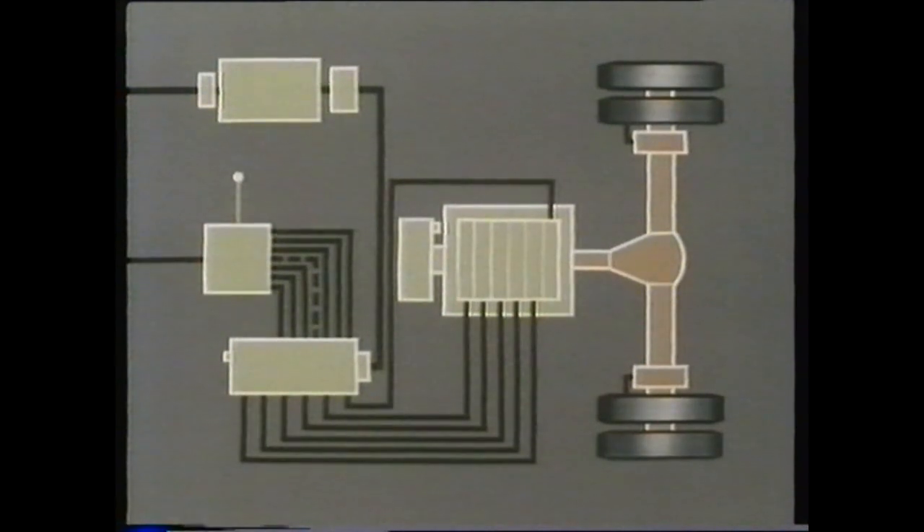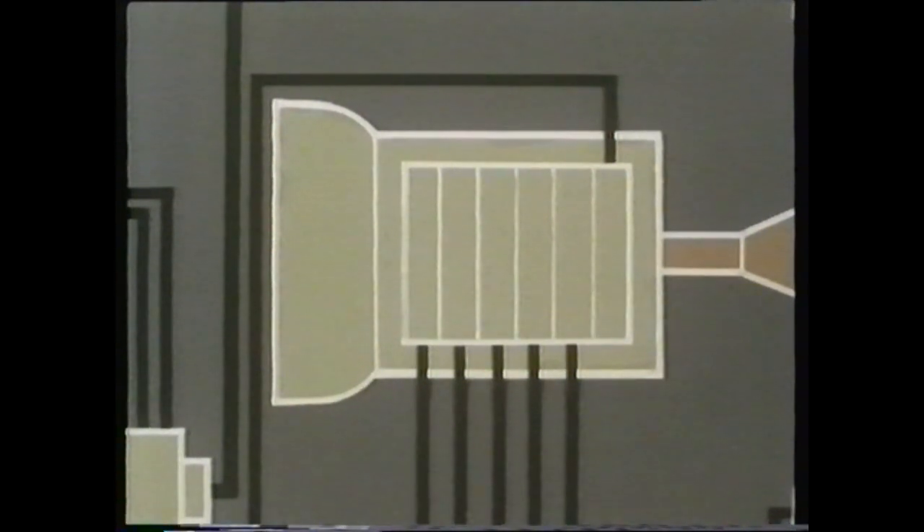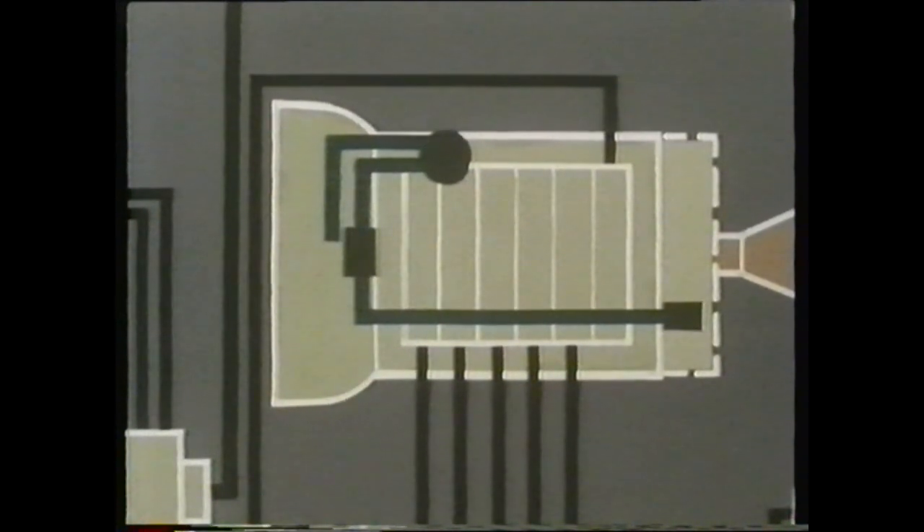There are two main types of pneumocyclic gearbox, but the main gearbox casing is the same on each type. This gearbox, for example, is a remote mounted type and, having a separate flywheel, both the gearbox and the flywheel have independent oil supplies. A Leyland National, for example, has a close coupled gearbox with a charged flywheel, meaning that oil is pumped through a pipe system from the gearbox to charge the flywheel with oil. The Leyland Atlantean also has a close coupled gearbox with a charged flywheel. However, since the engine of the Atlantean is mounted transversely at the rear, oil to charge the flywheel is drawn from and returned to the angle drive after lubricating the gearbox.